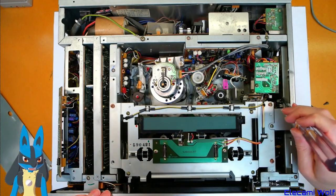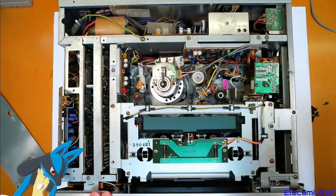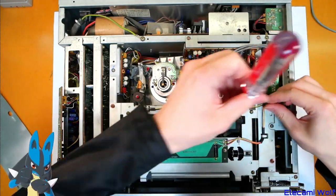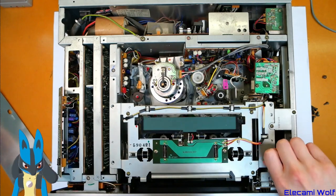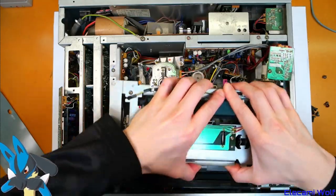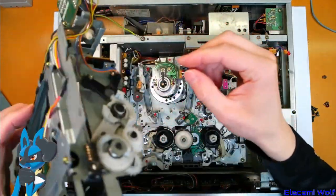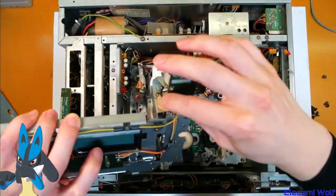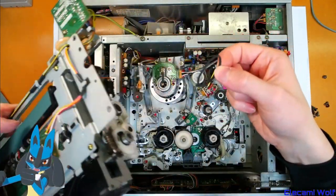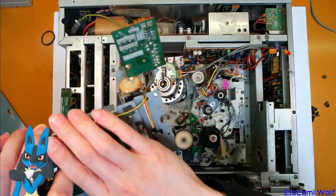There are four red screws here which will take the tape loading mechanism off. It's interesting that board in there is not very accessible because that's the main chassis piece. I think you can get it out from this side if we take the tape loading mechanism off — just those four screws and then disconnect it here. You can see the mirror there and the light bulbs. They've made it pretty easy to replace that belt, which is nice.